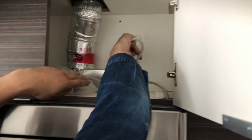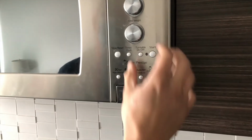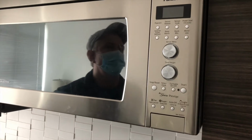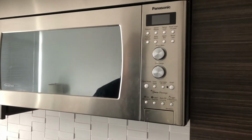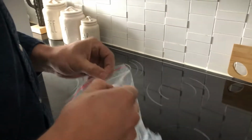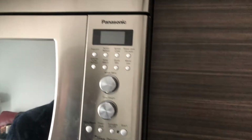As soon as you plug it in and you turn it on, it trips the breaker. So if I go to the breaker now, it's tripped. The root cause is the door switch. It's simply broken or misaligned. What usually causes that is a bad switch inside. I do have the replacement with me. Now we'll replace the door switch with this new one here.